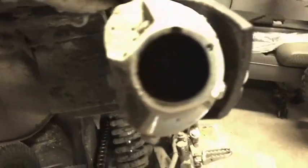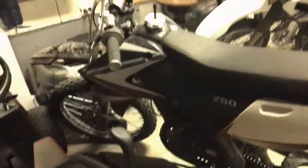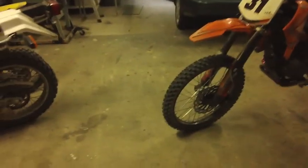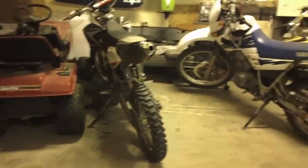put a different baffle in the muffler because the baffles that the Gios have on these 250s are crap. I think his blew right out the end even. I just put a bunch of metal wrapped in a ball and put it in through a bolt. That did it, and made it quiet enough. No problems. My bike's faster than his because it's newer, but his still really rips. They're both just great bikes. His doesn't have an idling problem with the carburetor. My carburetor is pretty finicky.